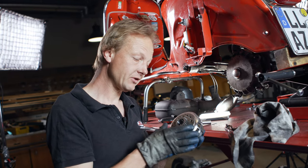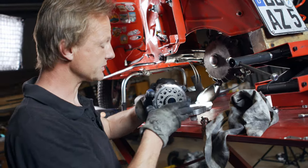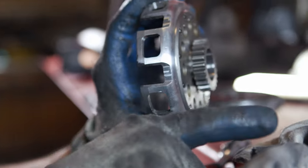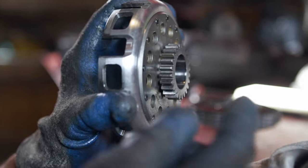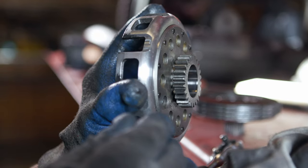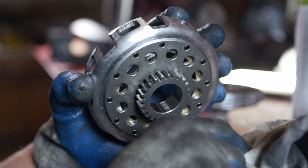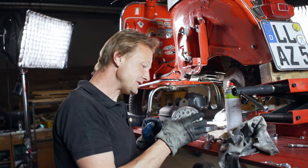I was told to see if the clutch gear is also badly worn. You can still see the transverse grooves that were created during manufacturing, just like the gauge. There are no vertical grooves visible, and it is not yet mirror smooth. In addition, no teeth are missing and it is not broken in. In my opinion, this all looks very good.